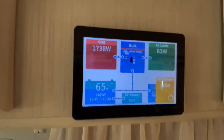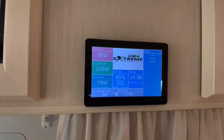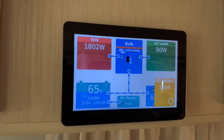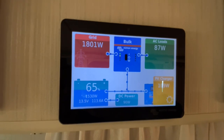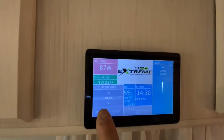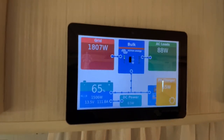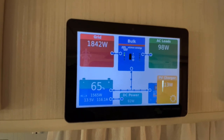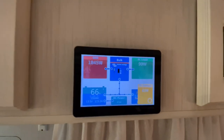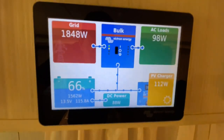That whole 120, if it was possible, I'll try and crank it a bit more. I'm pretty sure it might clip off, but we'll try 9. Maybe a bit more. We'll go 10, yeah? So 2,400 watts. Accept 10. Right, cool. See if we get a change. There you go. I reckon we've hit the limit, guys, and I think we have, because I've set that for 10 amps, which is, you know, 2,500 watts. So there we have it. That is the generator, a Honda 2.2, charging these batteries at that power. It's all going into the batteries.